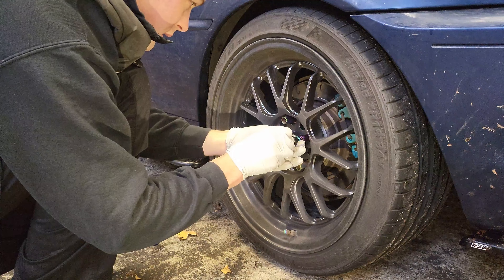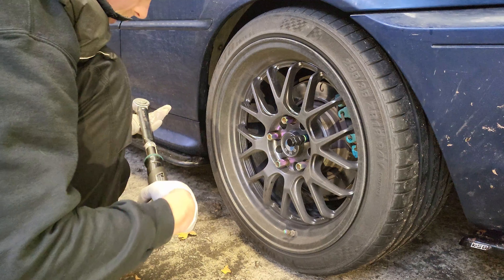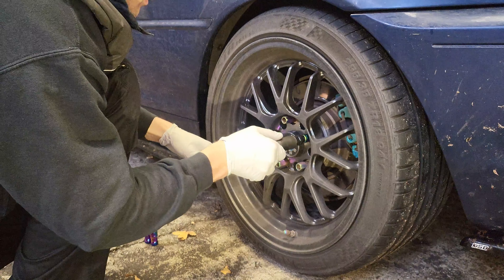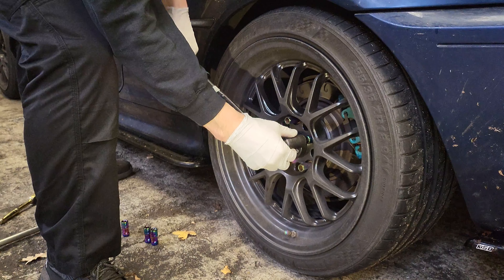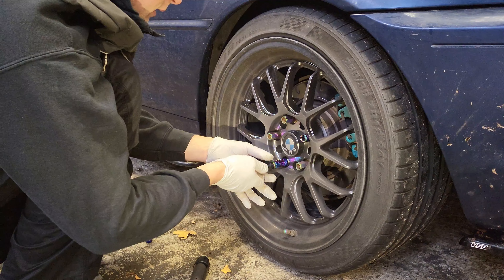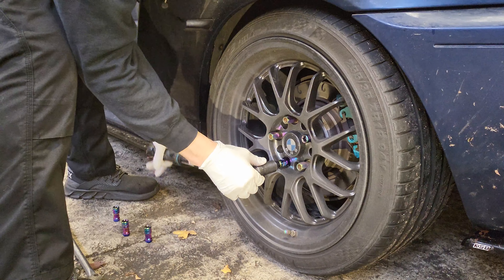I've got a little bit of grease on the stub, just so that the threads don't gall too much. I'll spin them in. I've got my torque wrench calibrated and that's set to 130 Newton-meters. Normally I'll push down, but I'm going to pull up this time because I don't want my body covering the video. Up to 130. That's it.